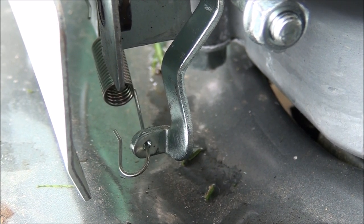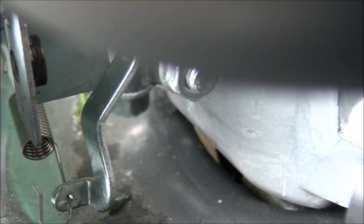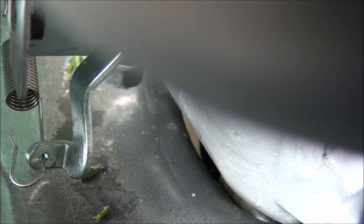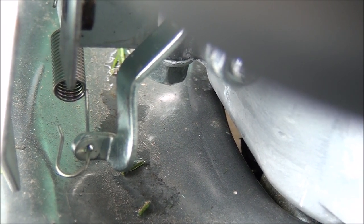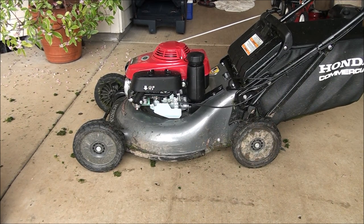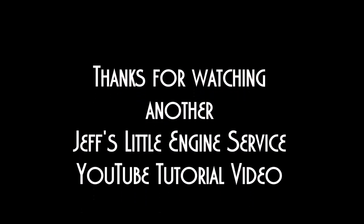If you're having trouble getting that governor adjusted, get it as close as you can and then move over to the spring. You can make up the adjustment by bending that tab forward or backwards — bending it backwards makes the spring tighter and increases your lawnmower's RPMs. After a lot of trial and error, I got this thing adjusted perfectly.